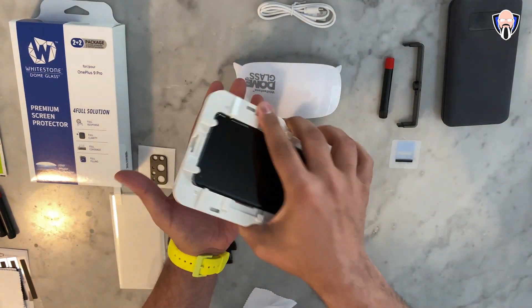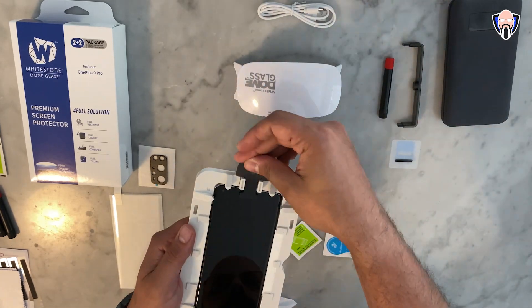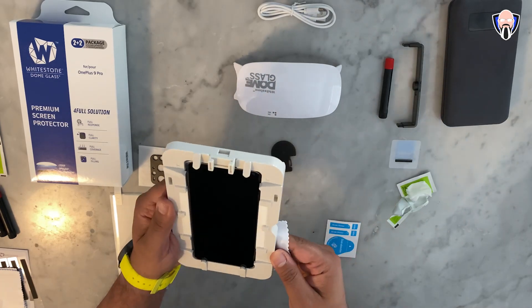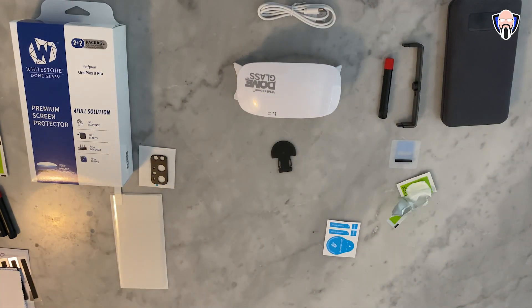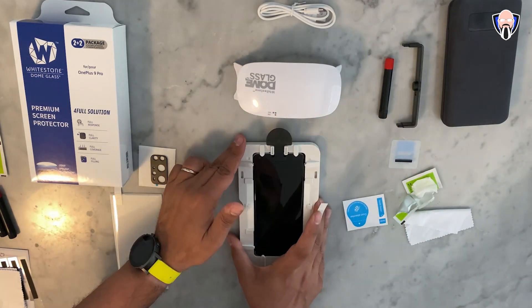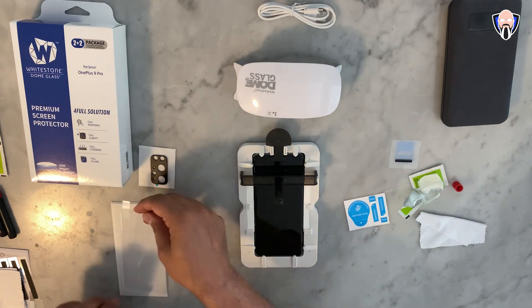Place the glass protector with the stopper at the top, then go ahead and release the adhesive from the top. Allow the glue to land on the top part of the display, then bring the liquid adhesive down to the center. Once you have that in, you can put in the glass protector, release it with the top cap and allow it to fall, letting the adhesive permeate throughout the display all the way to the top and the bottom.